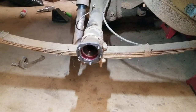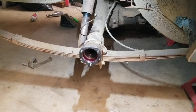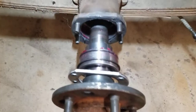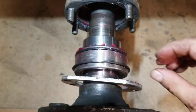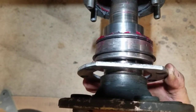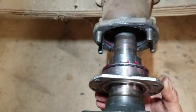Now we're moving on. What I'm going to do is go ahead and get our axle shaft back inside the rear differential. Real quick here — the axle shaft is in there, but you want to make sure that whenever you have these bearings pressed on, make sure you get your flange on there first before the bearing, because it's got to go up against that little snap ring to hold it into the axle tube.